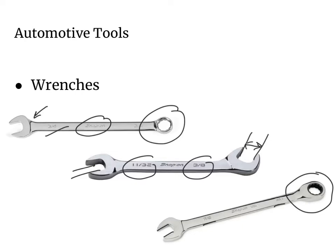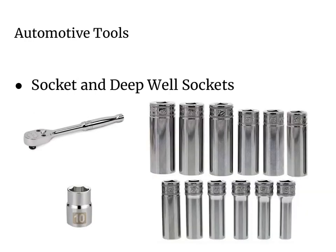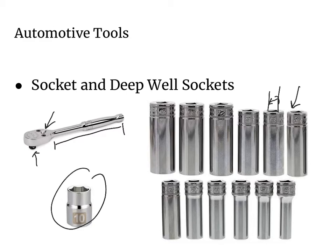Be sure to go out and buy yourself a good quality set of wrenches. Next, we have a set of sockets and a ratcheting wrench used with those sockets. The square opening of the socket handle fits inside the square opening of the socket itself. You'll notice a reverse mechanism sometimes labeled on or off depending on which way you want to turn the socket. Socket handles come in different lengths, and there are different drive sizes: quarter inch, 3/8ths, half inch, and 3/4. For the sockets themselves, you have standard sockets and deep well sockets, which are labeled with their size on the side.